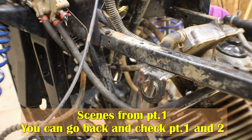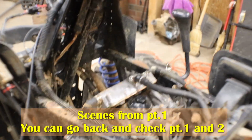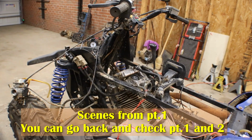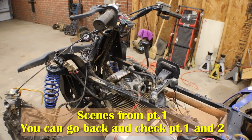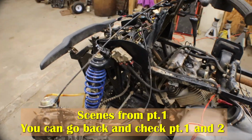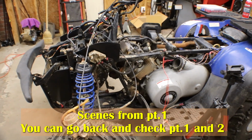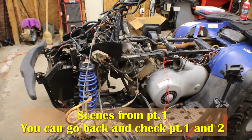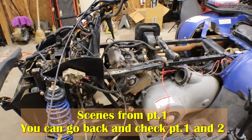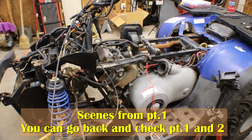It could be a valve that's not seating all the way, but it don't feel like it's got anything really. It's barely pushing my finger. So I gotta get the ignition system going so we can see if we got spark. Maybe we can get it to hit off on some fuel with the compression it does have, which is next to nothing. Maybe those rings are stuck because, like I say, it was stuck in the top end.